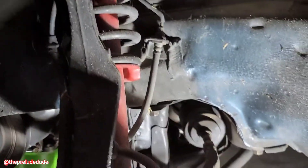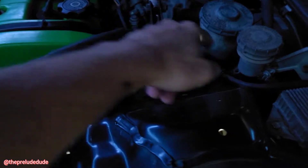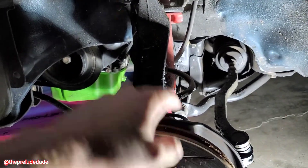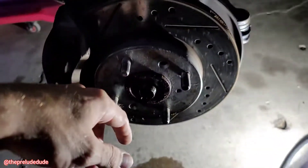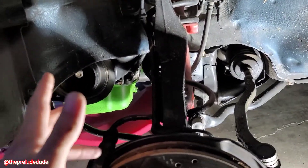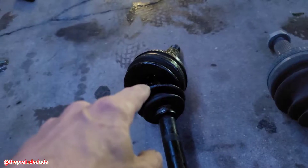If the rain holds off and we get all this work done, we'll be doing a cruise tomorrow. But it started raining on me, so I had to with great haste put this tarp up. I got the fork out, got that off real quick. I'm going to go through with degreaser now and try and degrease this, try not to get too wet — still just a hair of rain coming through and it doesn't feel good because it's super freaking cold. I'll drop these two nuts on the control arm down and then get under there and pop the CV axle off the intermediate shaft.